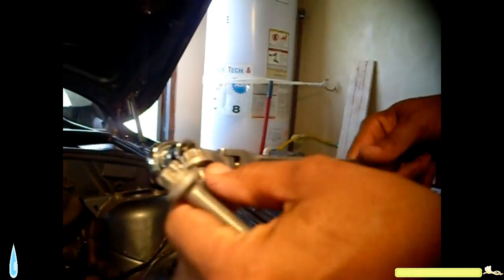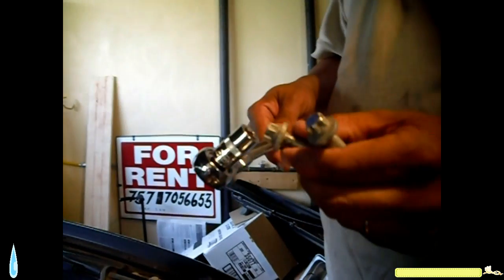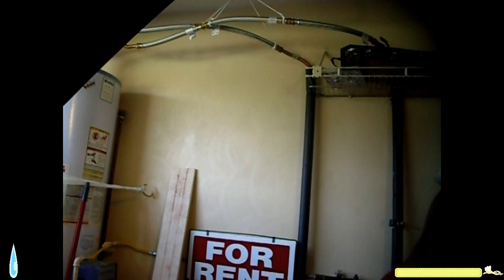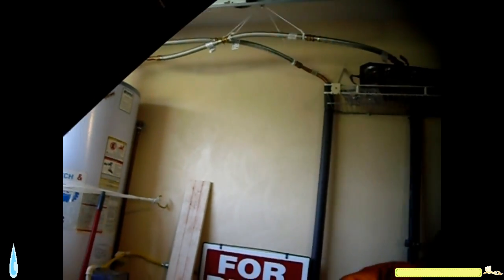We're gonna use the Torx wrench on this right here. The Torx wrench, in case people don't know what it is, with a swivel on it. You don't want to use anything other than a Torx wrench because the screw is aluminum. It's going to have an aluminum head, and if you use other wrench than a Torx, that aluminum head will strip on you. Once it strips, then you're going to have a pita to try and get it out.